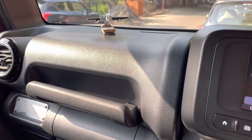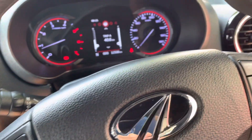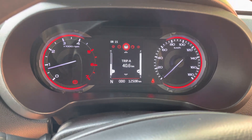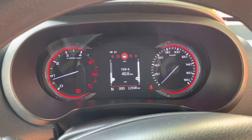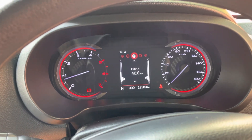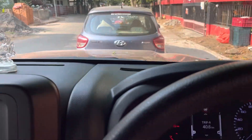There's no need to worry about DPF clogging in the diesel Thar. There are many articles online about why buying a BS6 diesel car is a pain due to DPF issues, but really all you need to do is spend five to ten minutes regenerating as soon as you see the warning. Park the car somewhere outside — ideally not in a garage — because the engine will run at high RPM and there will likely be some emissions from the tailpipe as the particles are burnt off.